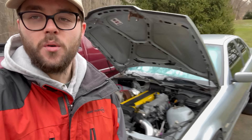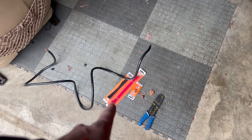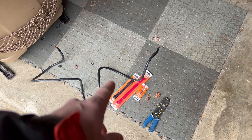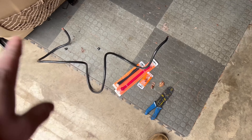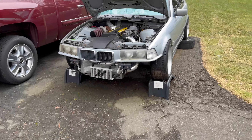All right, what's up? So one day turned into three — you know how that goes. I'm going to make up the power wire; I got all the parts to do it and I'm actually doing that right now. Let me flip the camera. So I just cut the ends off the wire, I'm going to put the little heads on, shrink wrap it, put some red zip ties on it so that I know that it's a positive wire because they ran out of red wire at the auto parts store. I'm probably going to end up replacing that at some point just because it bothers me. But other than that, we're pretty much just going to run the power wire today.